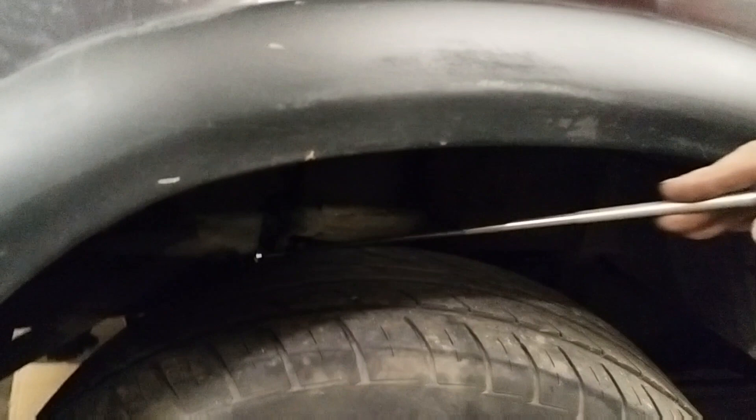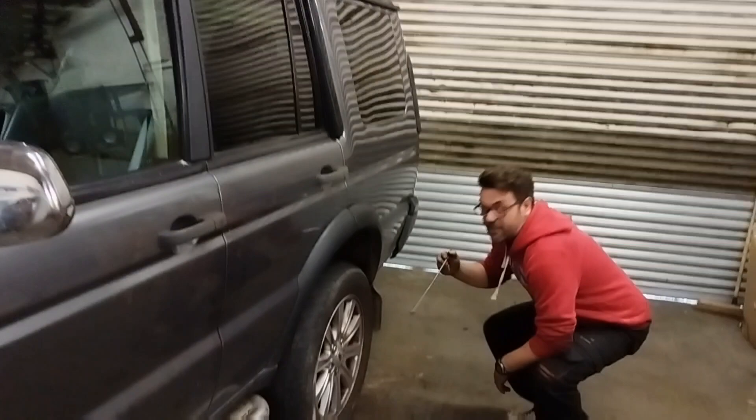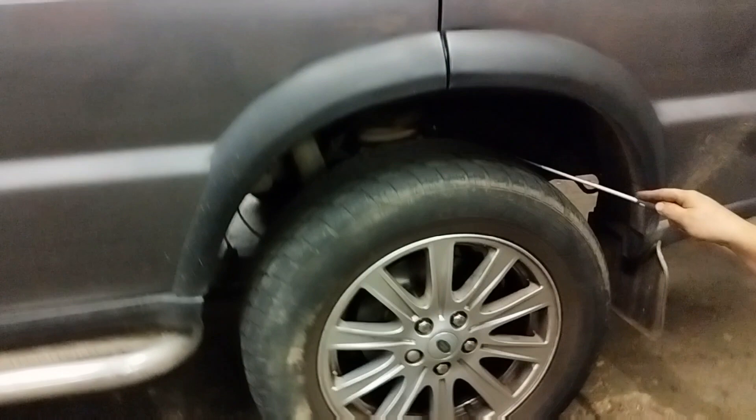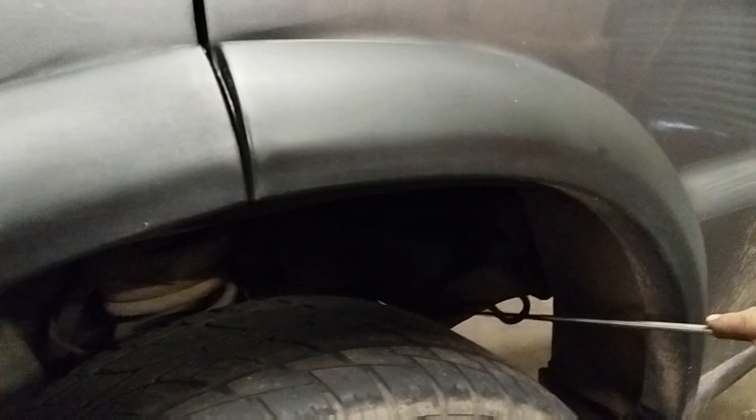While you're in this area, you can have a look — down there is the anti-roll bar bush. On the back area of the chassis, check where the shock mounts to the chassis. Those can rot off completely — we've had that happen where it's completely rotted off and we've had to weld a new one on. Check down the back of the chassis there as well, which you can see from inside.